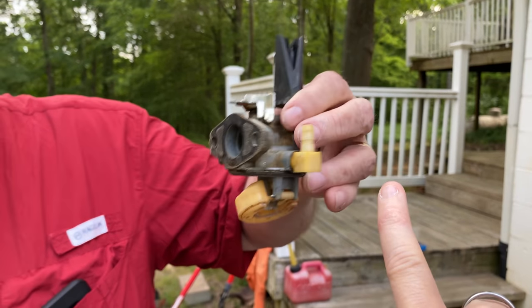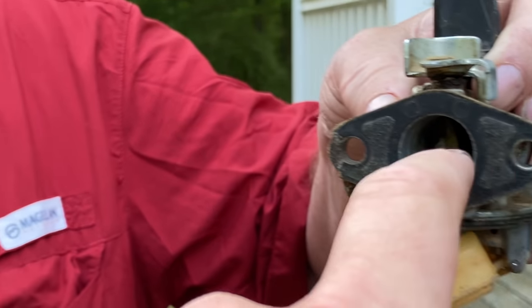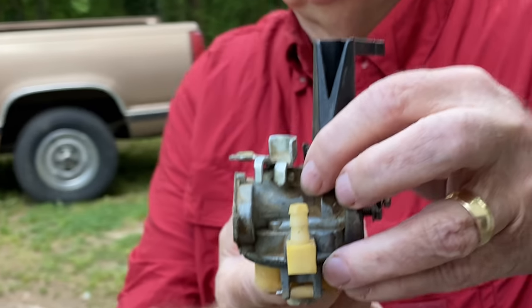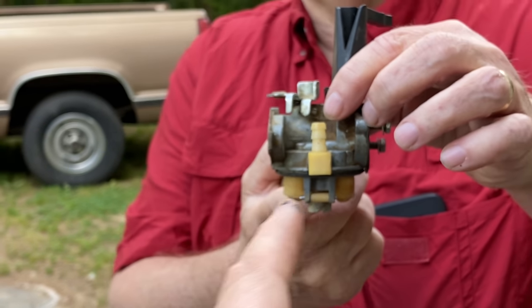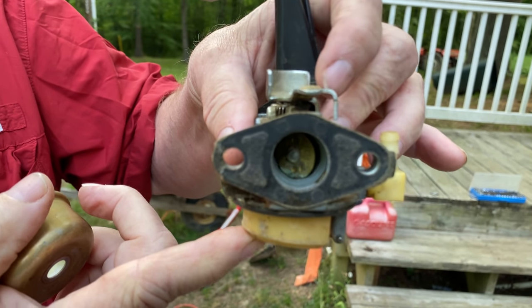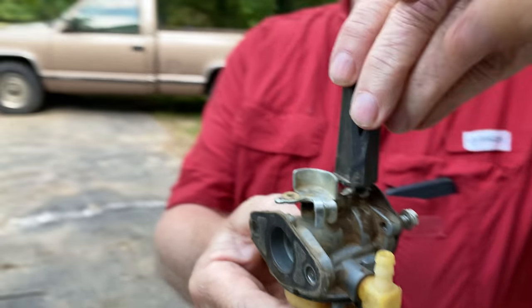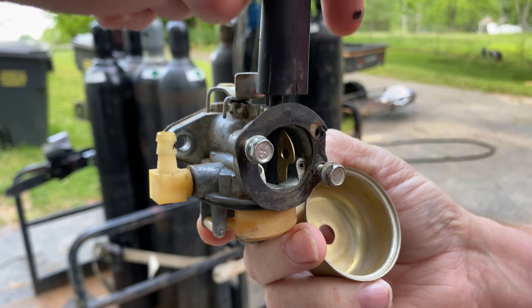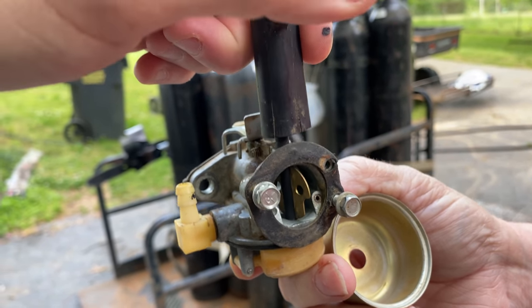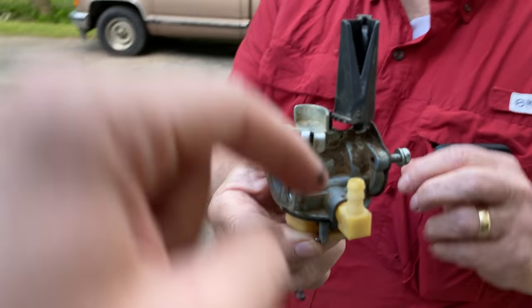So fuel comes in right here. You've got two valves - you've got a valve on the backside, that's the choke, and a valve over here, that's the throttle. Running open on the choke, you're running lean. If I want it to run more rich, I close that off - that prevents oxygen from coming in on this side. And so then the gas is coming in and going down into the bowl.